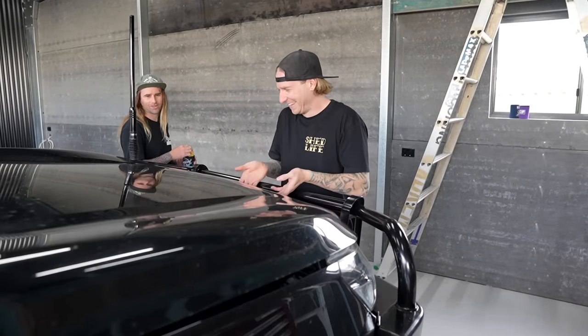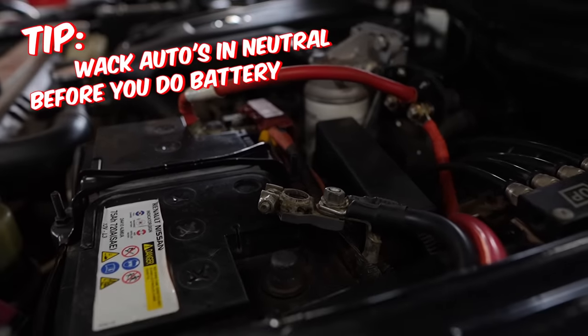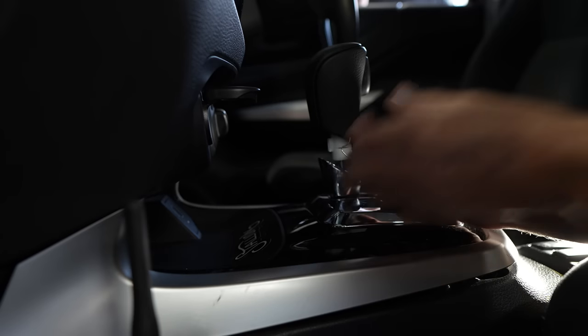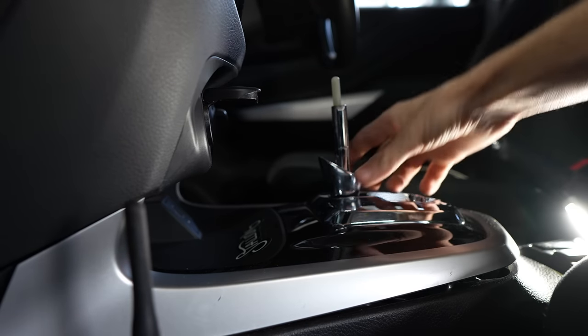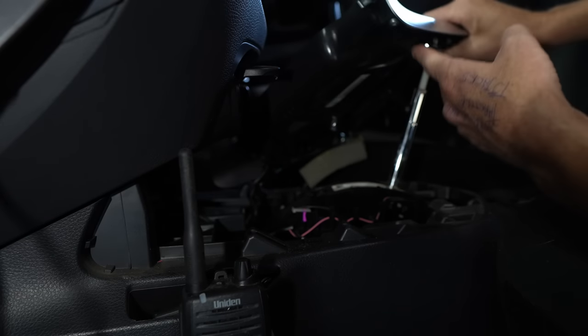It's actually a pretty simple thing to install. Start by popping your bonnet and disconnecting your battery. If you have the automatic, put it in neutral before you do that. If you've got the automatic, slide the collar down, pull the pin off the front of the stick, and lift the shift knob upwards — very important not to lose the pin. Use a pick or a small flathead screwdriver on the piece of console that surrounds the shift knob.